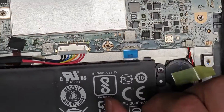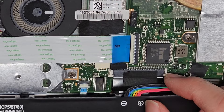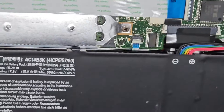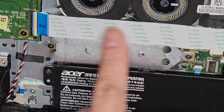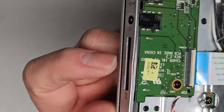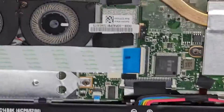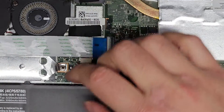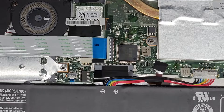This is most likely the touchpad/trackpad connector — there's a little flip latch here. Flip that and you can pull the cable out. You do have to take the battery out first. There's the keyboard backlight connector — same thing, flip latch. The keyboard connector has a little sliding latch that you slide down on both sides, then pull the cable out. I think this small cable is the fingerprint reader. Then you've got this big long cable going from the daughterboard to the motherboard. There's a USB 3 port, headphone jack, and SD card slot, plus the speaker cable going underneath.